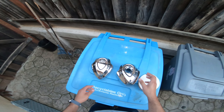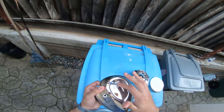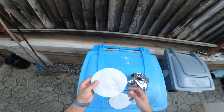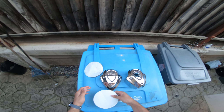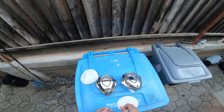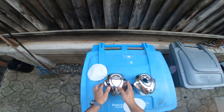We're gonna be blacking out the ignition and whatever this cover is. I've put in some sticky putty to fill in this area — I'm gonna try and keep that part chrome. So I think that might look pretty cool with everything being black and then the inside still remaining chrome, so I've put some putty in there to protect it. If you've seen the blacking out the mirrors video, the process is pretty much gonna be exactly the same. We're gonna sand this whole thing down with some 80 grit, then move up to 220 grit, put on a coat of self-etching primer, and then put on the black spray paint. For today I'm just gonna go ahead and sand this down, then maybe clean it up and spray paint it tomorrow.